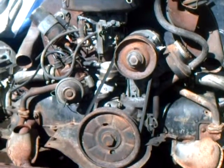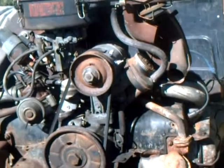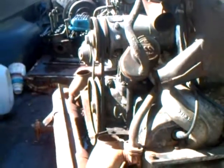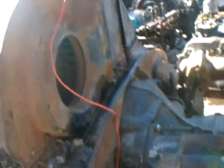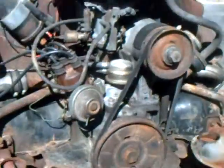This is an update video on my 1972 Super Beetle. Here's my engine after I got done getting it all put together. She was locked up when I first got my car — it had one bent rod and a fractured cylinder jug.